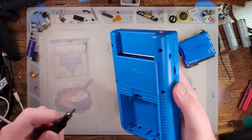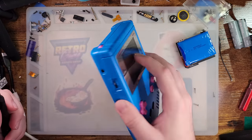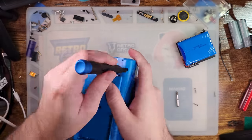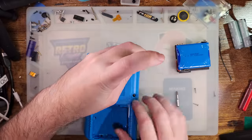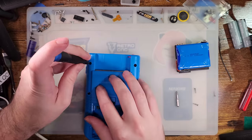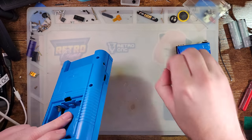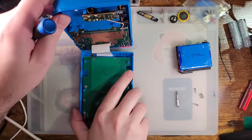Second reason I dislike this thing — I can't even get this one screw out. The battery says 7.4 volts, 1250 milliamps. This is why looking at just milliamps is a bad idea and why you have to consider wattage overall, because this is a two-cell battery. Each cell has 1250 milliamps worth of capacity, but because the cells are in series the capacity is calculated a little bit differently.